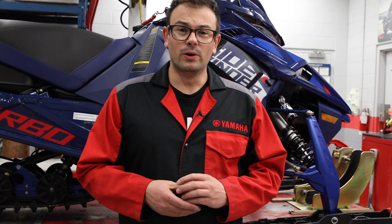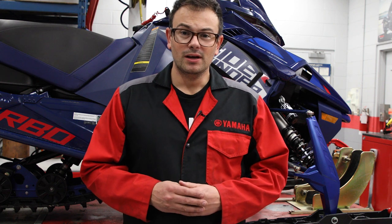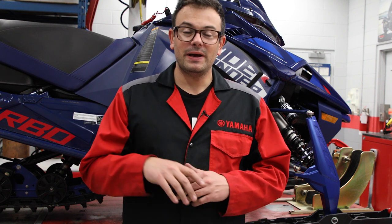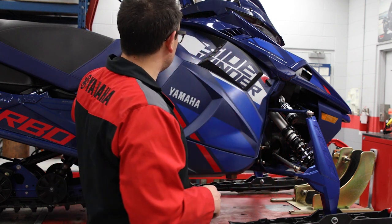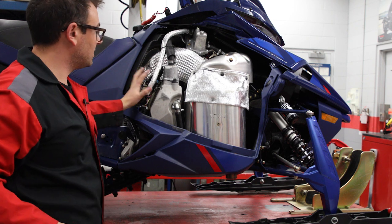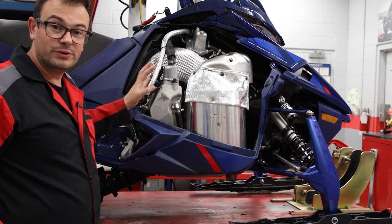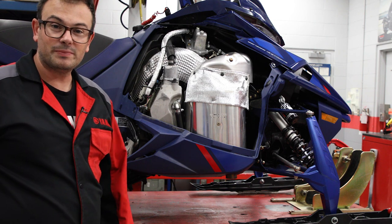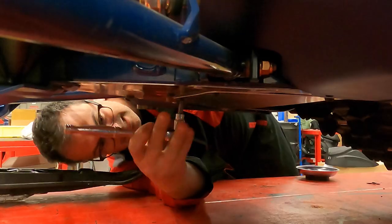We're gonna start on the oil change of a Sidewinder snowmobile. First, we need to drain the bottom of the engine. So we're gonna take the access panel off from the bottom. We'll also pull off the side panel on the side, as we are gonna have to drain the dry sump of the motor here. So once we do those two, we can start the oil change process with the filter. So follow me now as we start by taking off the bottom access panel.